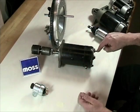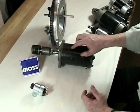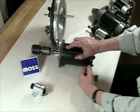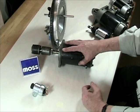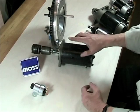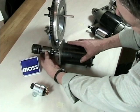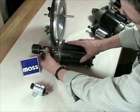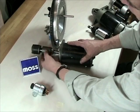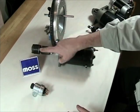This is the starter motor — the power goes in here. Now a person with a lot of American car experience might look at this and say, I don't understand why the pinion gear is past the flywheel — it's always on this side of the flywheel. In this system, no. As power goes in, this motor begins to spin. The pinion drive is on a screw gear, and if it doesn't make as many RPMs per second as the motor does, it moves outward to make contact with the flywheel. When you let go of the starter motor and it reverses itself, it comes back and parks. So the pinion gear lives on the far side of the flywheel.